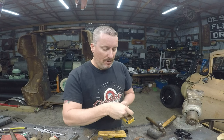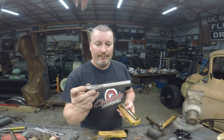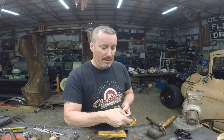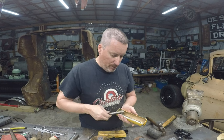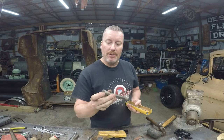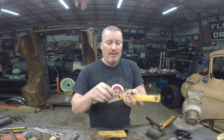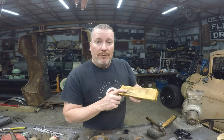You don't have to have the kit. You can just go with the reamer and knock the bushings in by hand with a hammer and whatever you can figure out to use, like a socket or something like that. But this one's really handy because it's stepped to go down inside that bushing. So again, .814 is the reamer size, and that's what you need for early Ford, 28 to 48.